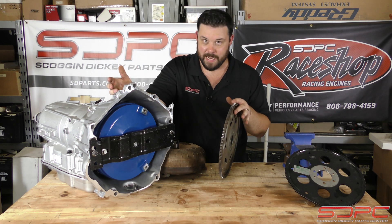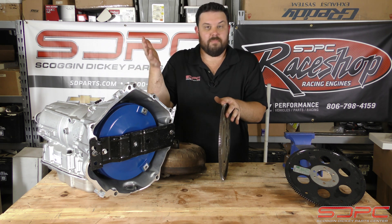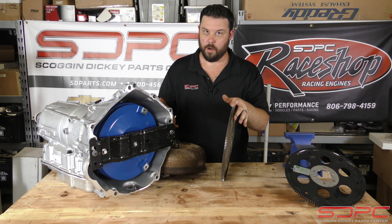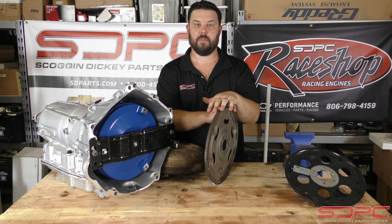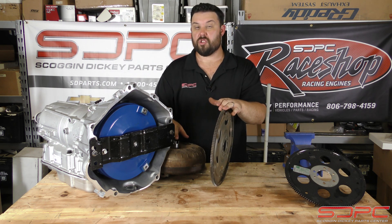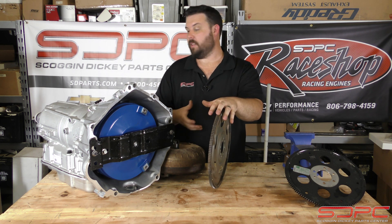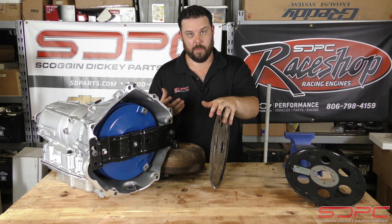Remember, these things generate a lot of heat. When you first fire up in the morning, it's kind of snugged off. When you're hot and you're romping on it and you're at the racetrack enjoying yourself, they can actually expand a little bit. You need a little bit of wiggle room, or you can get situations where it balloons so much it pushes against the crankshaft thrust bearing and ruins that — we've seen that before. We've also seen it where it balloons so hard the torque converter pushes against the pump in the transmission and actually breaks it. That's not a transmission rebuild, that's a replacement — that trashes everything inside of it. So you have to be careful about that.